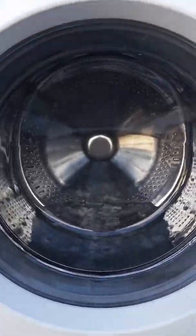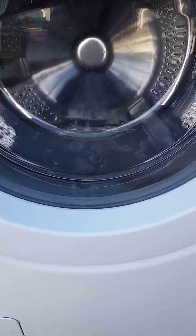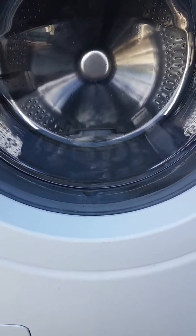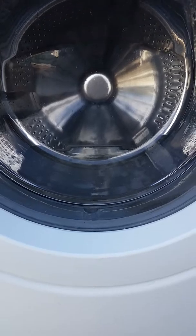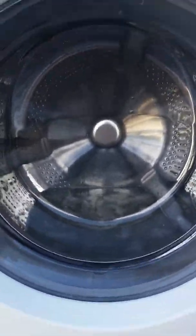You've probably heard it has a slight squeak noise. It's not a big deal — it's the right rear shock absorber, which lets the drum drop a little bit when spinning. I've taken it apart and checked it; the plastic is fine and the absorber part is fine. It's just the way it mounts. The previous owner may have overloaded it with comforters or something, which can definitely wear out shock absorbers.